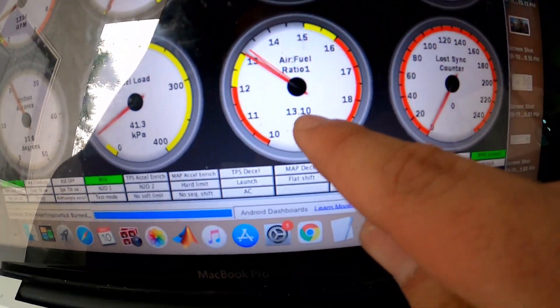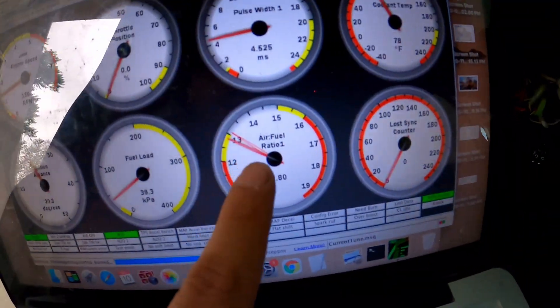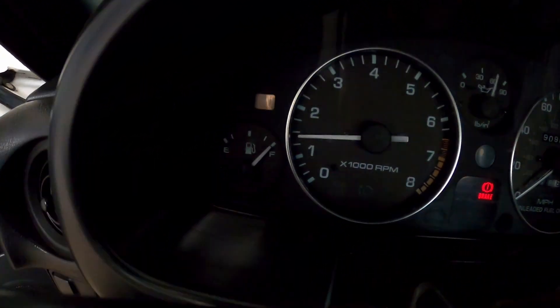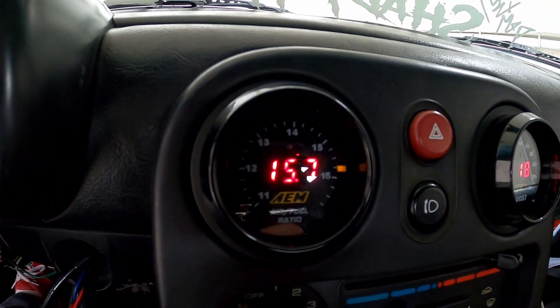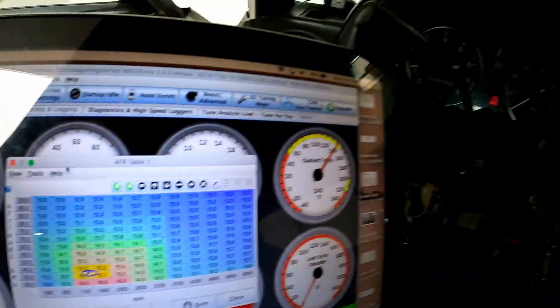My AFR is reading like 13.1, 13.2 — that's about right. The air-fuel ratio on screen and what's actually being read are pretty close. I'm just going to let it warm up and see how it runs once it drops to an idle RPM around 860. Now that the O2 sensor warmed up a bit, it's running pretty lean — like 15.7 — and it's showing about 15.7 on the chart. I'll let it warm up completely and maybe test drive it; I might have to adjust the fuel a little.